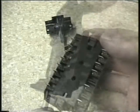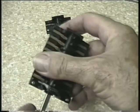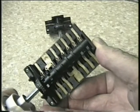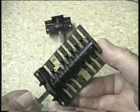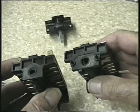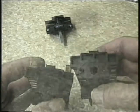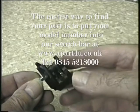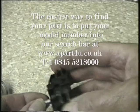There is also a large variety of switches by each manufacturer, so you do need to be sure you are replacing the switch with the one that is designed for that machine and the element or hot plate it will be operating. One way to locate the correct switch is to type in your model number in the search bar at apart4u.co.uk and you will get shown a list of all the relevant parts for that appliance. Once again you can see the locating pins on the rear of the switch that hold the piggyback thermostat. If you have given the correct information to the supplier you should receive the right switch, but check it anyway because some switches look the same but are slightly different.